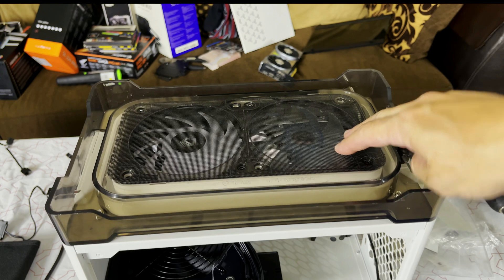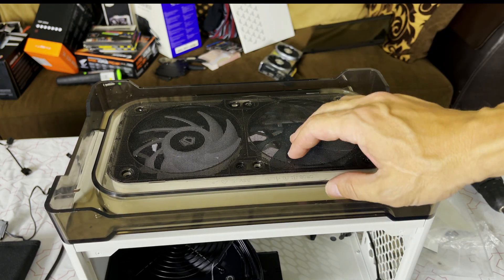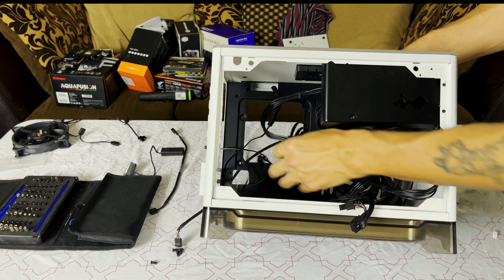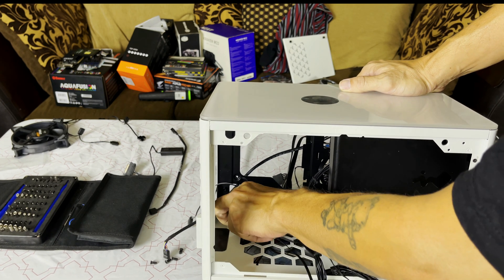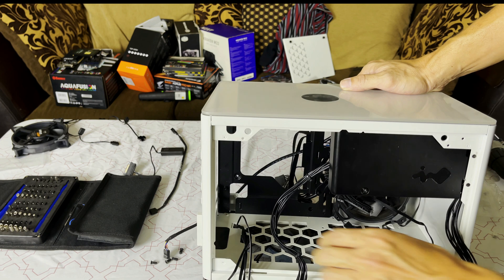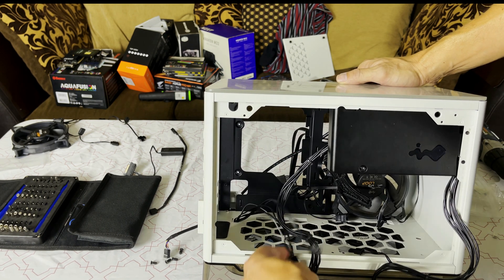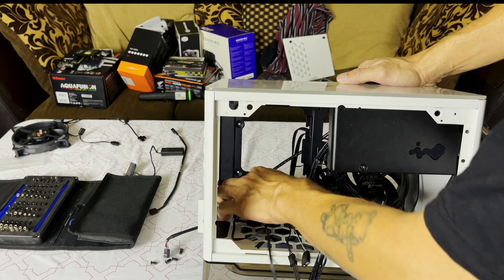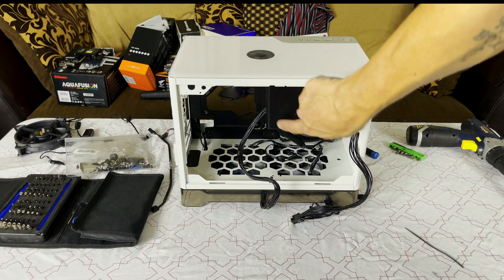This is why I said we want to do fans first — this way we're not flipping and flopping everything in the computer. Let's take a look at what we accomplished. This little channel down here is where we brought our fan cables up, making sure nothing's coming up through here. This hole is where we're going to run these through. Let's get everything out of the way because we're going to have to put our motherboard in. You can remove this cover that covers up the power supply.